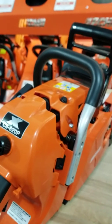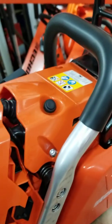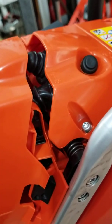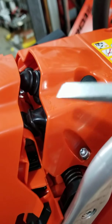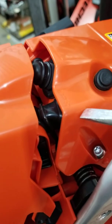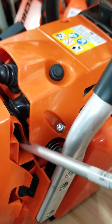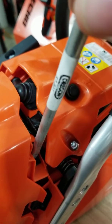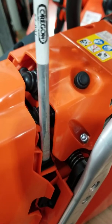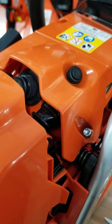The question was: what does that mean and how do I make the transition? It's a little different on each saw. This one is the 620P, which would also be the Timberwolf, and right where that mark is, right up here, there is a rubber boot that transitions from the engine cylinder area with the cooling fins over into the carburetor area. Right down here at the base is a black plastic piece — I'm just sliding the screwdriver in there and prying across the top, and that slides over, which moves it to the winter mode.